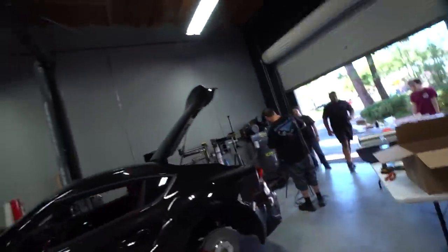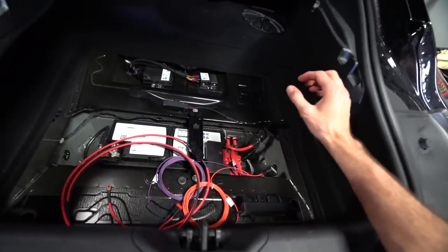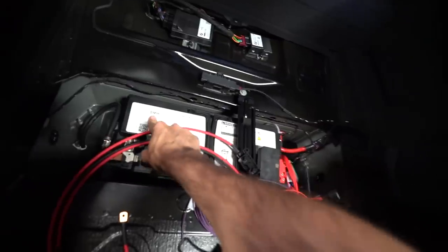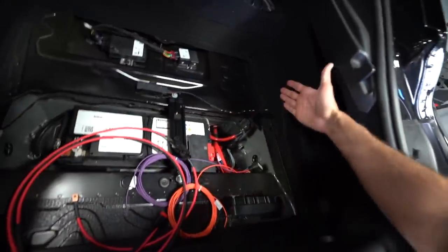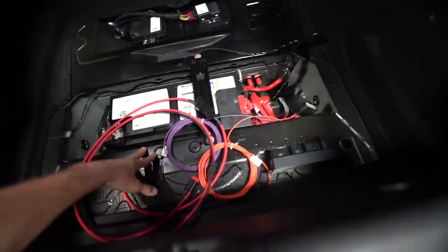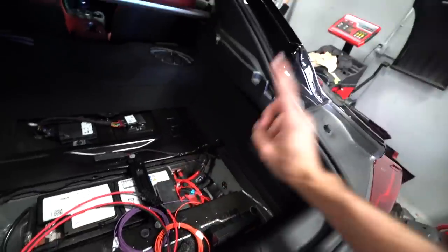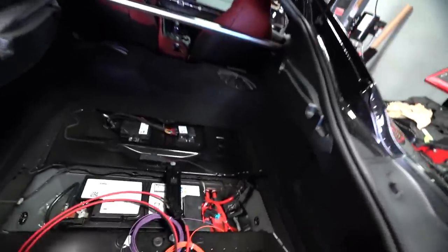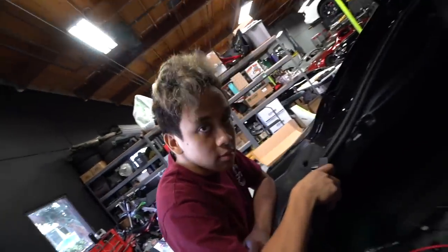The tank is going to sit in the back, but there's still some wire management needed and we need to mount a couple modules. What's awesome about this car - and yes this is Toyota but it's really a BMW - is the rear trunks usually have these trap doors. On Kevin's BMW he was actually able to fit a three-gallon Endo-CVT completely invisible. On this car we have a battery here but still have some extra space, so we're going to mount all this stuff underneath and hide it. For running the lines from the tank to all four corners, we got very lucky that there are grommets on both sides. Rather than drilling holes and putting bulkheads, which is more permanent, we're going to take the safe route, go through these grommet holes and fill with instant gasket to make sure no moisture gets in.